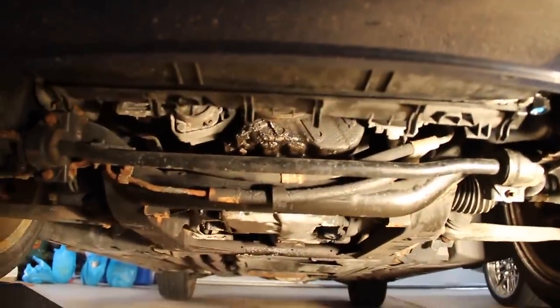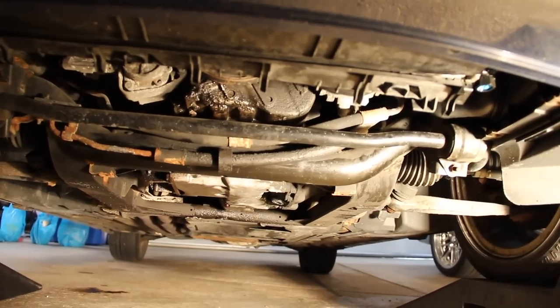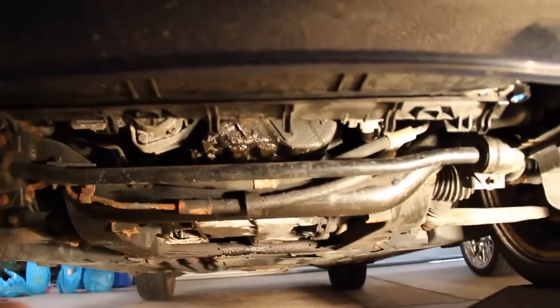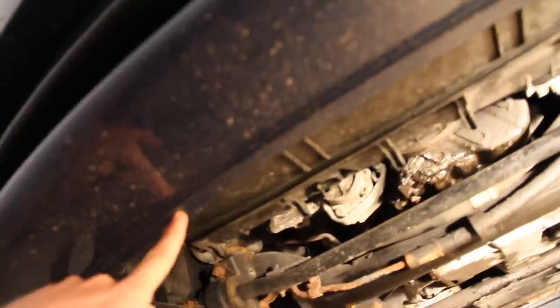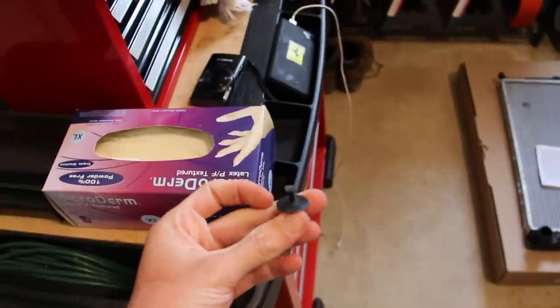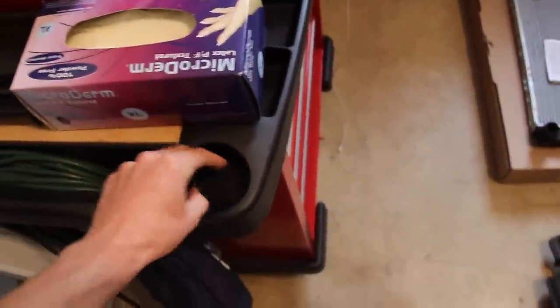From there, you're going to need to get down and remove the engine splash shields. There are two pieces of plastic, at least on the XI version. They just come down with a bunch of those little quarter-turn Phillips screws — release any of those that you see. In the front bumper, this car has the M Aerodynamics package. There are two little plastic pop rivets — you pull out the center piece and then they just pop out with a pry tool.